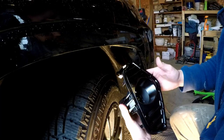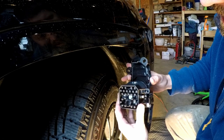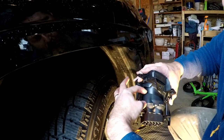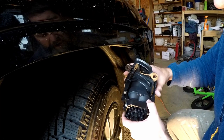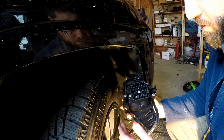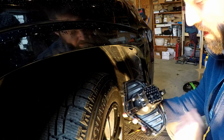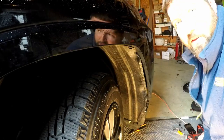Time to install the light. It's all installed. Just like the other side, the lower bumps are raised so it's pointed downwards. If you're confused putting this together: the shroud goes inside, the longer part of the shroud goes on the inside, the longer part of the brackets go on the inside, and the plug is always on the bottom. The instructions mention a Tacoma, Tundra, and Corolla but nothing specific about a RAV4, though their website confirms it's the correct part for a 2019 and up RAV4.